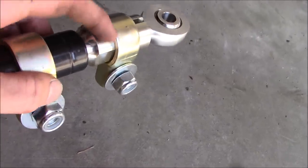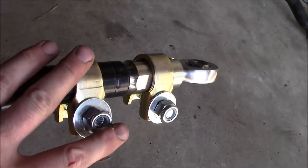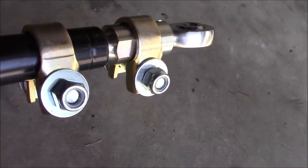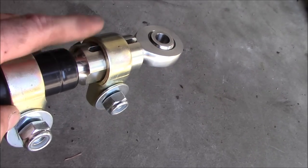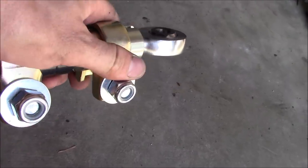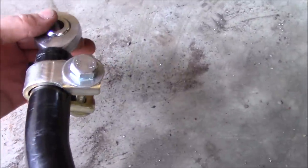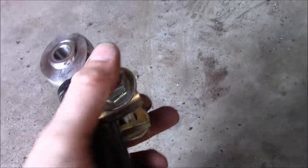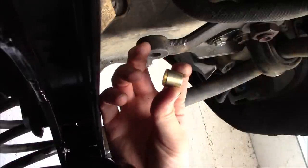Before install we need to make sure we're putting the clamps on the correct end, along with the adjuster and heim joint ends. This is the pitman arm side and you need two clamps here. There's an option for a third if you're running a steering stabilizer. This adjuster piece threads in on the left-hand side — that's how you know you're on the right side. Then we thread in our heim joint, and I have the clamps tightened down just a little bit — not all the way — because we still need to make some adjustments. On the other end, the heim joint threads directly into the end with a clamp ready to go.